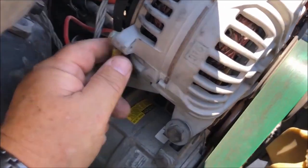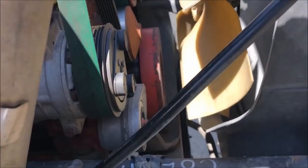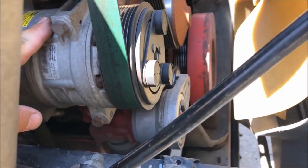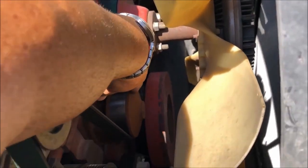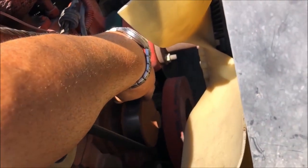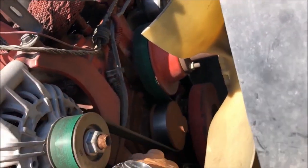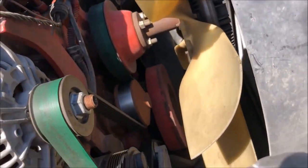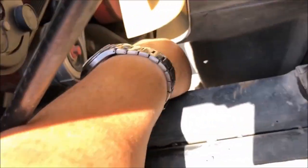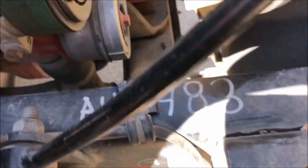The alternator is electrical, and all the electrical wiring is securely mounted to the back of the alternator. On this side here is the other air conditioner compressor, which is also belt driven on the same belt. Then we are going to go to the water pump — it is securely mounted, I see no water leaks, and it also is belt driven. The belt cannot have more than three quarter inch play. I am following the radiator hose down to the bottom of the radiator, and I see no leaks. It is securely mounted with clamps.